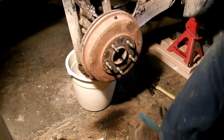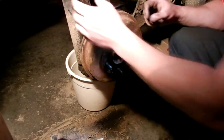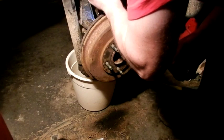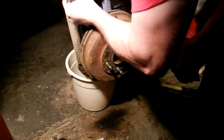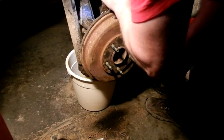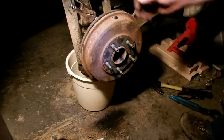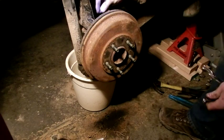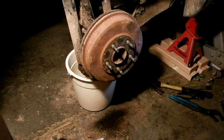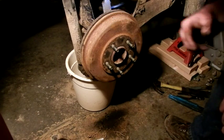I jammed a piece of wood into the brake pedal. Let's see if this does anything — oh yeah, it blew out some air. Let's try it again. Let's see if we can get just solid fluid out. Okay, that was all fluid. So I'm going to cap that off. Do we detect any leaking? Nothing there. It's too hard to tell if that's leaking because it's just got fluid all over it.